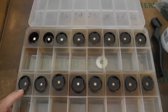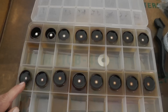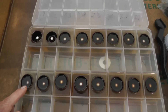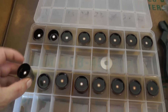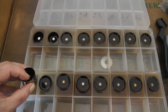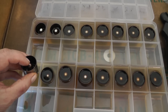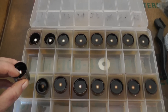The idea is to take out the clearance in there. I talked to the machine shop about this — I went down and had a good conversation with them. The reason you do that, from what he's saying, is that these buckets — as they're called — are under spring tension when the valves are open. That spring tension is going to push the piston down somewhat, and then when you take the camshafts out it's possible that the piston could actually come back up a little bit.